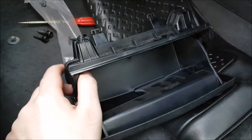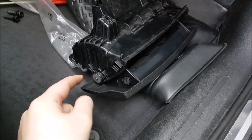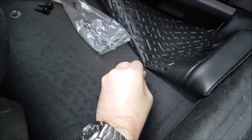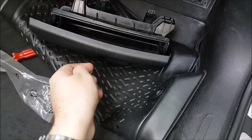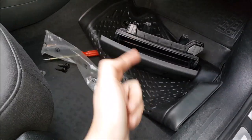The problem is that the way I'm doing this, I have no possibility to put in this screw. This one is easy because it's opened up, but for the other one I need to take this out — I need to undo this screw and this screw right here. And for that I'm going to use a little torx, it's a T10. So I will take out the front of this storage compartment and then I have full access to it and see what I can come up with in terms of screws to hold it in.